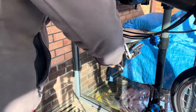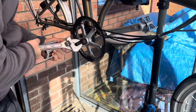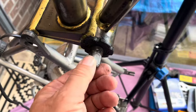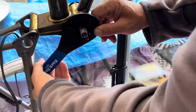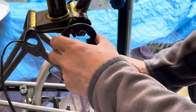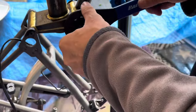Here we're removing the cranks. You will need the correct tool — a crank puller. It took a real amount of force to loosen the crank on the drive side. Nothing really wrong with the bottom bracket; it is a little notchy, but I'm changing it for a lighter one. This job is much easier with the correct tool. There are different bottom brackets fitted on Bromptons depending on the age and model, so check the number of notches on the fitting and make sure you've got the right tool.